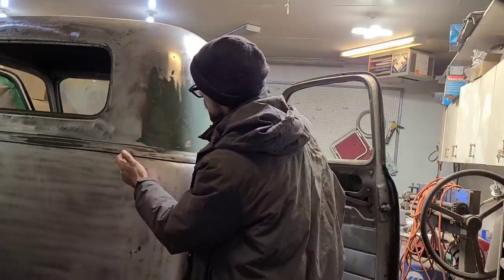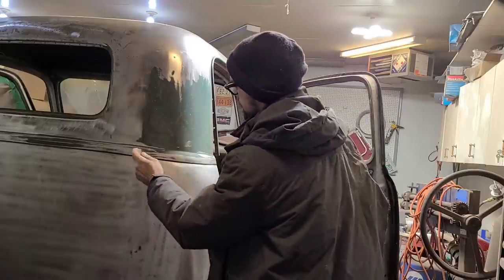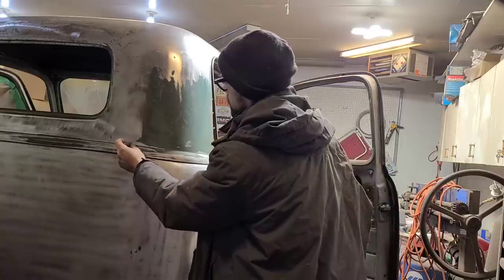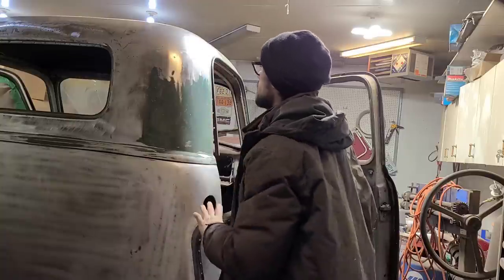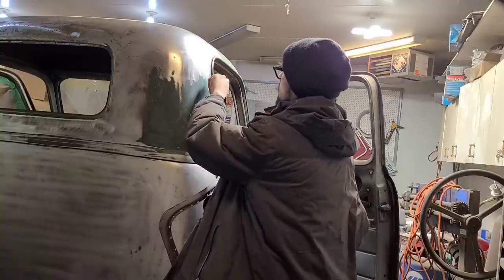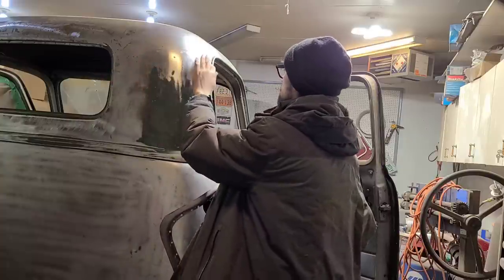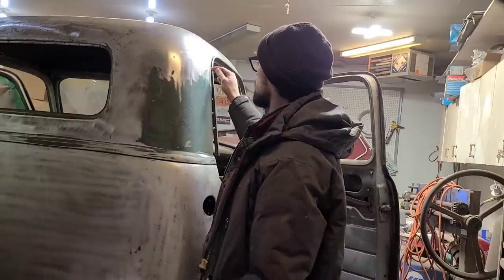And then what I did is, I just drew a line between this actual dimensional measurement and just the rough laying it on measurement. I kind of made a line there, which is going to give me about a half inch or so all the way around of extra material. And then at the top here, there's not really any accurate way to measure this rounded thing. I mean, there is, but that takes a bunch of time. So all I did is I traced around, and then I just eyeballed a half inch down from that and drew another line, which you probably can't see on the camera, because I'm just using a pencil for that. But there is a line there, and I'm going to cut to that lower line. I guess we'll stop talking and start cutting here.